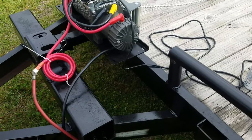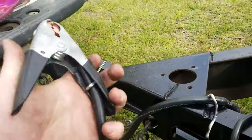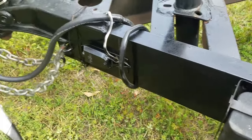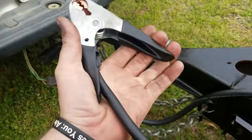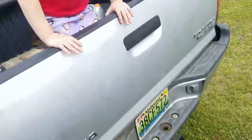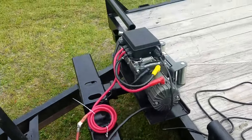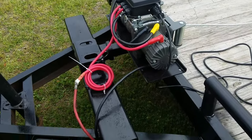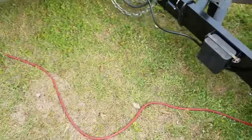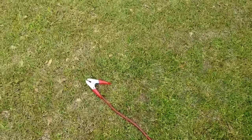What I've done is I went to Interstate Batteries and bought these little attachments right here. This is the wire that came with the Badland winch — it goes up here, it was an open end, put it to this, just ground it. As far as the power source, I didn't want a battery back here, so I got a 2-gauge power wire that's easy to wrap up and ran it right up here and put a jumper cable on it as well.